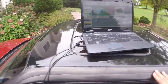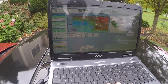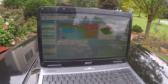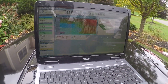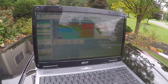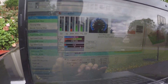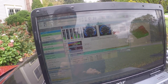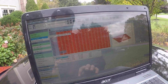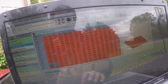I wish I had a dyno. Unfortunately, I can't really take this computer with me because the battery is pretty shot — it doesn't hold a charge. Otherwise I would love to just take this for a little road tune, do a quick data log. I also just want to see the gauges here real quick. Timing is a little bit off. We're at 10 degrees right now at idle, where it should be reading 15 degrees. That right there is a little bit worrisome — I'm not really sure why that's all zeros.